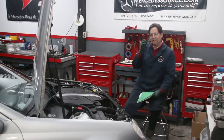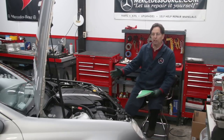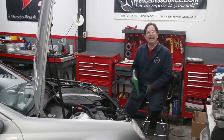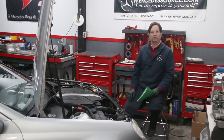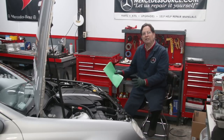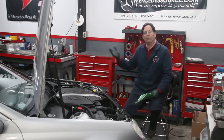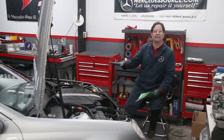Right in the mix of all that is the principle to do the easy thing first. This is like number five: if you're going to gamble with parts before you absolutely know what the problem is, I put a maximum of $100 on that. If you go have the car tested at a shop or run diagnostics, it's probably going to cost you $100 anyway. So if a part is under $100 and might fix it, that's fine — but if it's a two, three, four, or five hundred dollar part, diagnose first.